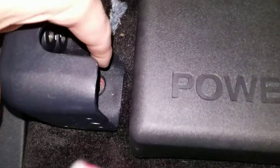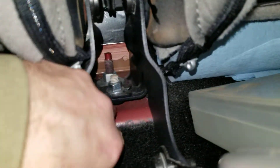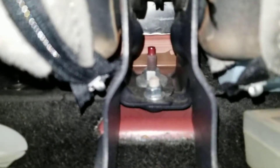There's one on each side of the power inverter — you can see it's out here, and one on that side. So there are four total and the seat should come up; you can see there's a gap. Actually I have to take this one too — there's one right here, so that's five bolts total. I can't tell what size that last one is, I believe it's a 15 millimeter. I'll have to use a wrench on that one.